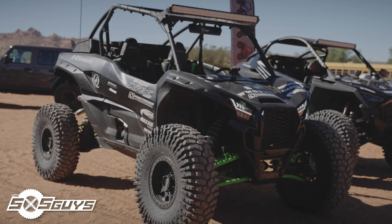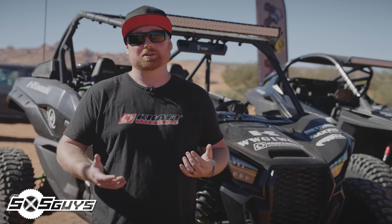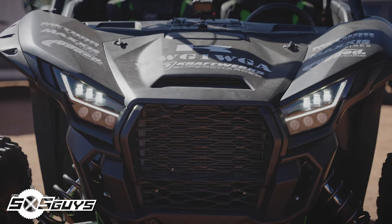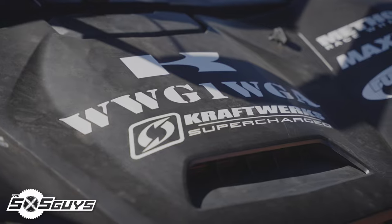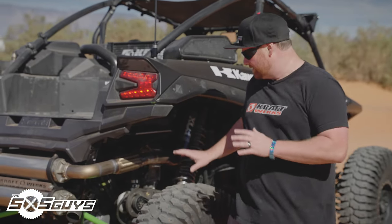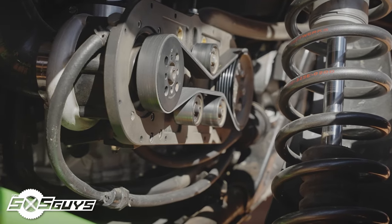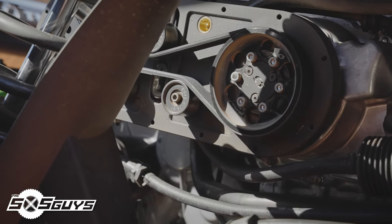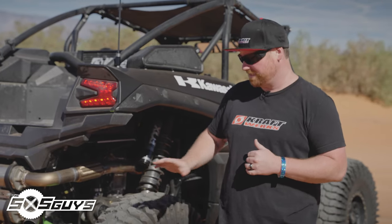Another kit that's new for us this year is the Kawasaki KRX. We've had a ton of customers jump on this because it's a machine that really needs extra power — it's overbuilt and extremely heavy, and even more so with the four-seater. It was almost like Kawasaki planned for a supercharger, because it adapts the same way as their alternator kit — just swapping out the stator cover. We have an adapter that bolts directly to the crank to spin the supercharger. Our base setup is about 8 psi and 130 wheel horsepower. Stock, these do about 11.5–12 seconds 0-to-60; with our kit you're in the sixes — almost cutting it in half.